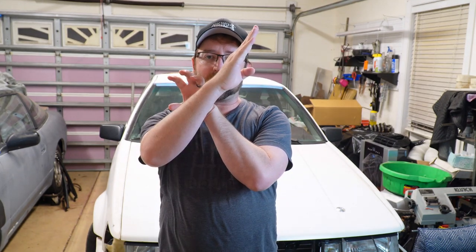What happens is on an AE86, you adjust caster from the bottom using the tension rod. That pulls the whole bottom suspension forward. So you've got your wheel, your control arm — the tension rod pulls it forward while your strut stays back. What I was finding is that as I tried to get more than about three and a half degrees of caster, I had to keep trimming my fenders and bumper to make clearance for the wheel and tire.